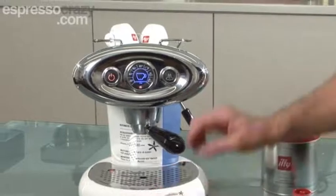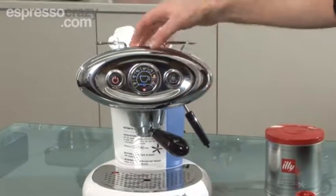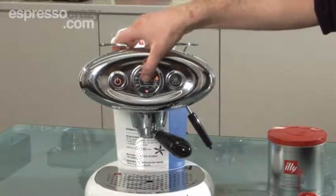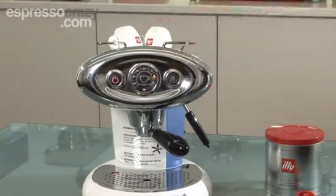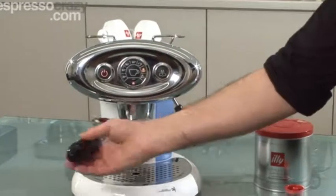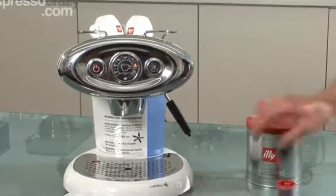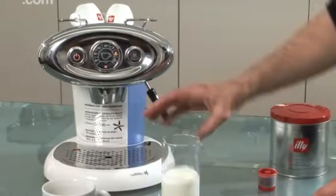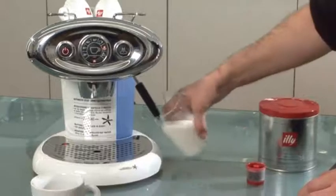Move the cup aside. Now you want to go straight into steam. We started making espresso between 88 and 92 degrees, but to make steam we really need to get the steam boiler up to about 135 degrees. I'll just remove this handle so you can see what I'm doing, and to make life a little bit easier, we put the milk into a glass or jug.